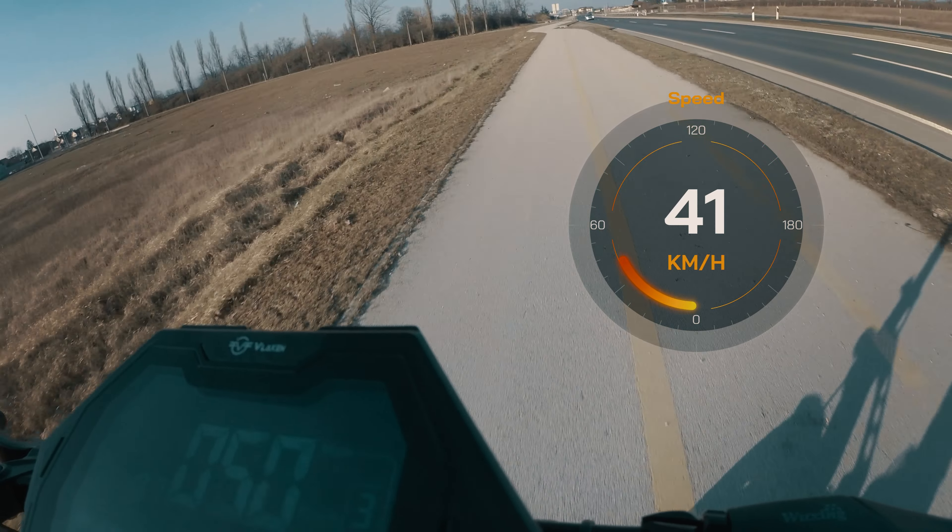The speed test is finished. We got results I was hoping for. We did manage to get to 55. I know that it's all about settings — the scooter is set up to show 55, but the actual speed is probably 42 as I said before. And that's really not bad for this scooter. There's no need for this scooter to go 55. We have three modes: 15 kilometer, 32 kilometer and maximum. In each of these three modes, not only the speed but the power is limited too. When you are in second mode, this scooter feels like a 600 watt scooter.